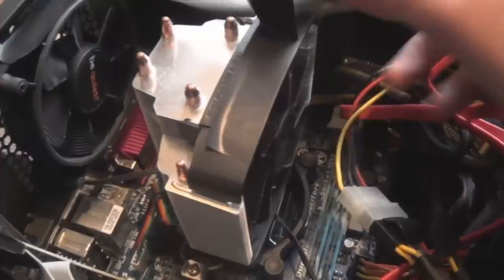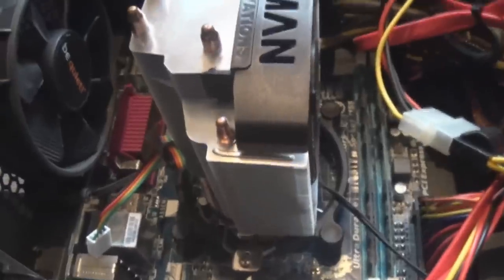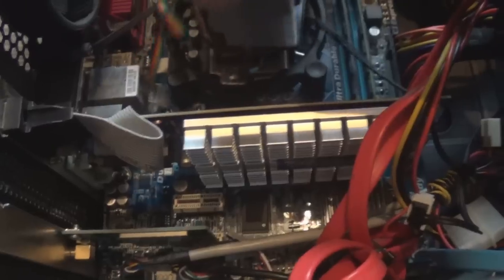There's a bit of plastic on top — that's actually a fan shroud that I built, just because it guides the airflow from the heat sink to the rear exhaust fan. We're going to take our old cooler off first — unplug the PWM connector. This one has two screws on each side, and it's probably easiest to also unplug the CPU power connector. Loosen those screws and it'll just come off.